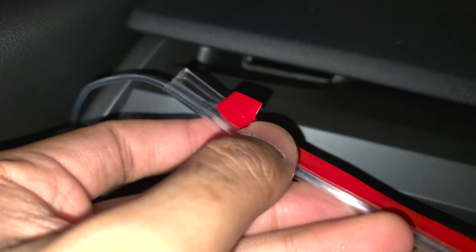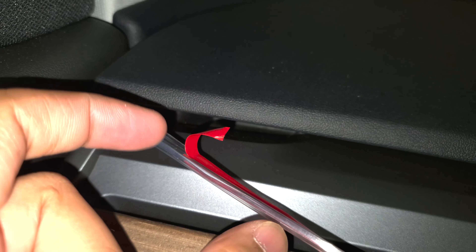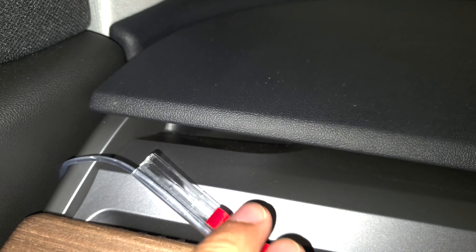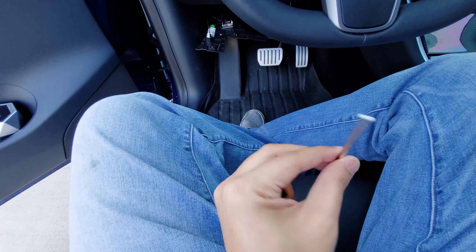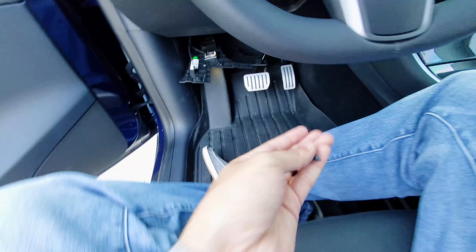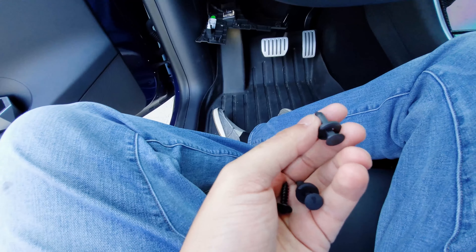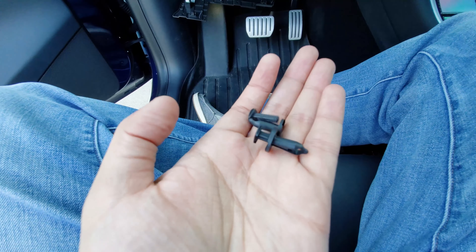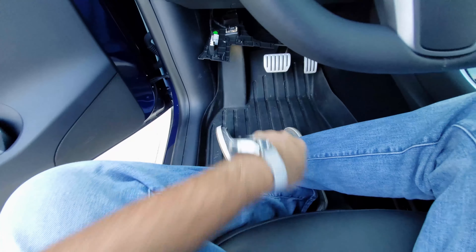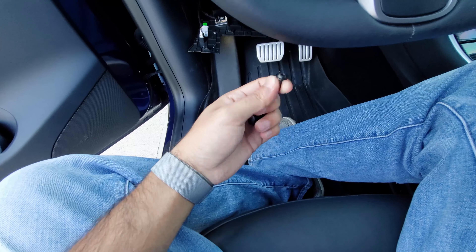As you can see, I am taping the top piece to the bottom of the light tube. It doesn't matter which side you put it on because either way it's going to be the same — just one side is going to have the adhesive. You want to go nice and slow so you don't overlap the tube itself; it's only on this long part towards the back. You want to basically tear off the edge and start on the driver's side because this is where we've got the light plug that plugs into the fiber optic cable. Test fit it on the bottom right here, and once you've got it test fitted, go ahead and start taping it. They do give you a hex Allen key, and you need that because you've got to remove a total of three screws — two rivets which will pop right out with a flathead, plus this hex screw.